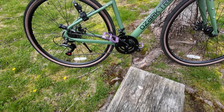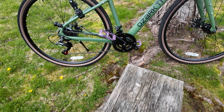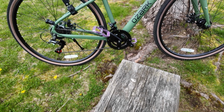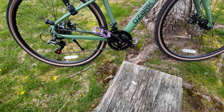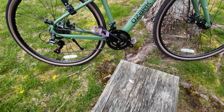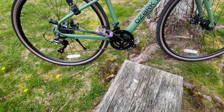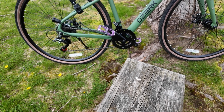So that is nice. Then the front gearing here is decent. It's acceptable. The shifter works pretty well. Now, it is a square taper bottom bracket, which does not bother me in the least. It is a sealed square tapered bottom bracket. I saw that on another video. And unfortunately, the gears and the chain rings here are pinned, so they're not something that can be changed or altered in any way. I'm assuming that they're super heavy as well. So one of the first things that I will be looking at will be swapping out that chain ring and the cranks. I have a couple of options on hand, and we will see which works and which doesn't work.